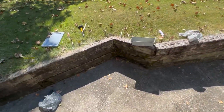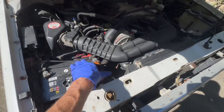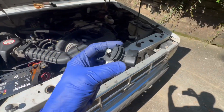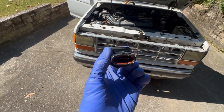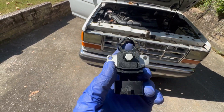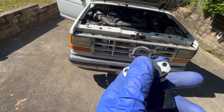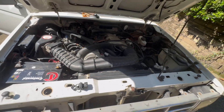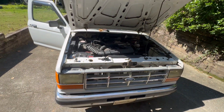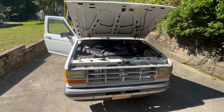My other video will show you how to get at it. The pickup coil looks like this — this was my problem. You can see it's four pins. I did put a voltmeter on the old one and the new one, and I was getting extremely different ohms when the meter was set to 20K. So I knew this was the problem, and sure enough, we replaced that and it fired right up. If this video has helped you, you can really help me by subscribing to my channel and giving this video a thumbs up. Thank you very much.